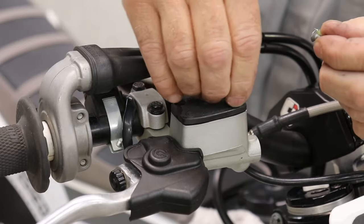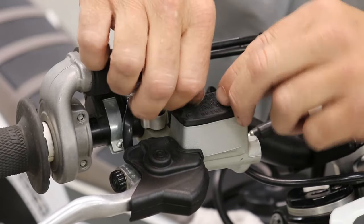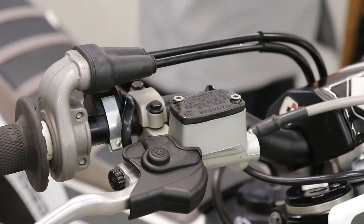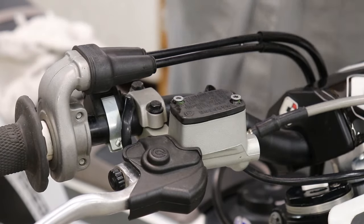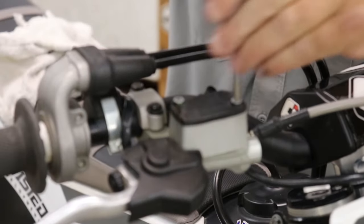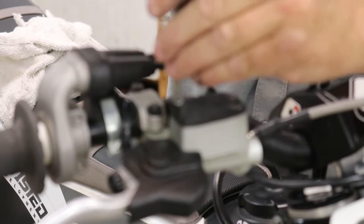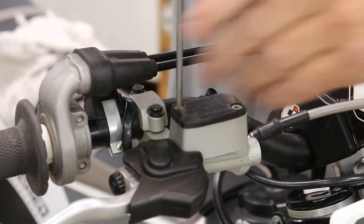I'm putting the grease on that surface, not so much the threads - the threads aren't what sticks. If anybody's worked on bikes a lot, they've had these fail, you know, strip out. Especially the Japanese bikes - they have a Phillips head here, and we've had to drill out so many over the years because they get seized in place. So you just go like this, and they don't have to be that tight. You don't want to over-tighten these.